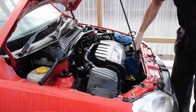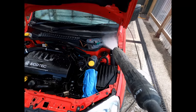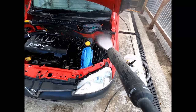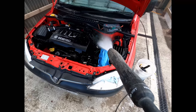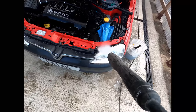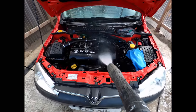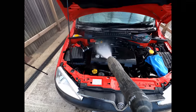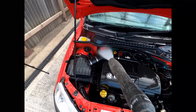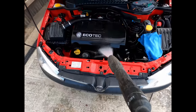Interestingly, some more modern cars have a base coat which will be red with lacquer over the top, and what can happen is if the red paint fades underneath the lacquer there's no way of restoring it. This happened quite badly on a colour called Milano Red on Hondas - some of the Civic Type R's and Honda Jazz's back in the day would sometimes need a complete repaint if that paint faded under the lacquer because there was nothing you could do to restore it.